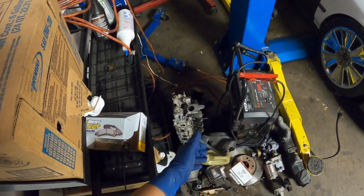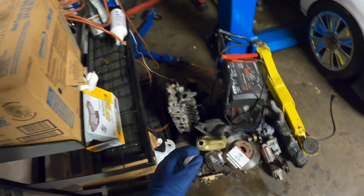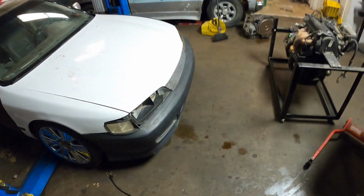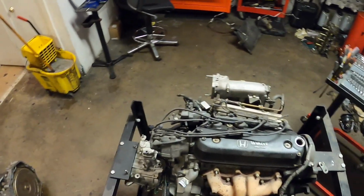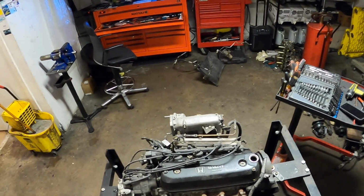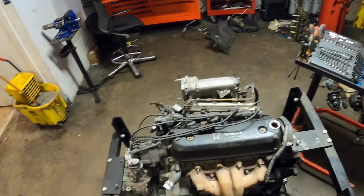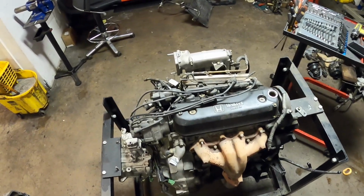If you didn't already see it, go back to part 2, I believe, of the $200 car video, and you'll see that those burnt valves are the reason why that car had no compression. Now, that car was cranked so many times, and the oil I drained out of that car smelled like gas, so I'm sure the cylinders are somewhat washed down with that fuel. But we're going to play around with it anyways and see what we get.